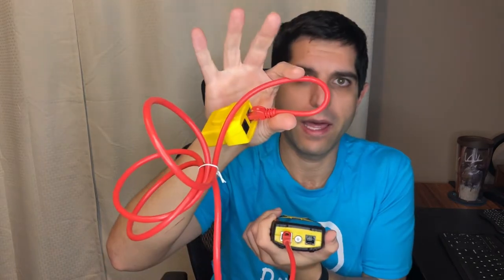Noise constitutes any type of interference on the line that could slow you down — such as surge protectors or a bend in the wire. My cable company came out because I was having issues with the new modem, and when they opened the box I saw there was a sharp bend in my RG6 cable. He unbent it, re-ran the test, and the noise rating was reduced significantly — it boosted my connection and made it extremely stable. He showed me a graph of before and after.